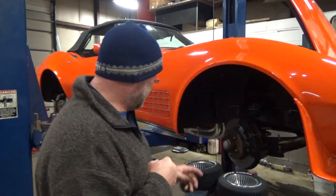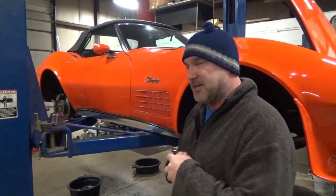We're going to get this thing down onto its new tires because we picked up some Cooper Cobra Radial GTs to make it ride nice. The 20-year-old tires that were on it were not great. When I did drive it, I didn't hear any abnormal noises from the transmission — everything shifted fine. Other than changing lanes when you hit the brakes, the brakes were working. We're going to resolve that by bleeding the brakes out, and there were no noises from the rear end.